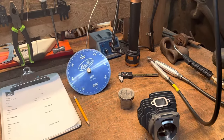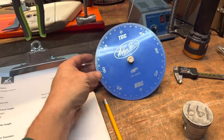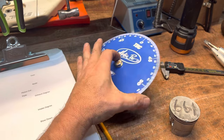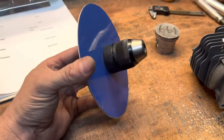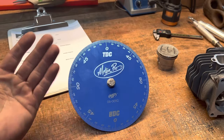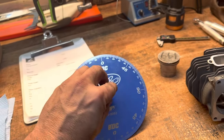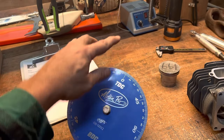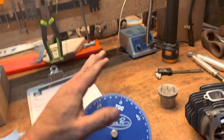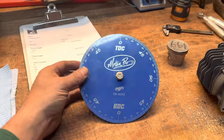First thing — if you're going to tear into a saw, you need to know where you're starting. Build yourself a degree wheel. You can find them online, super cheap. This is mine, with a keyless chuck for a drill. When I pull the saw apart and pull the clutch drum off, I set that keyless drill right on the end of the crank, find top dead center using a coat hanger off the case, and then start rotating the piston down to find out which numbers you're on.